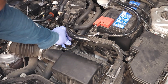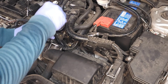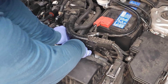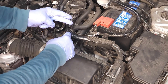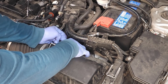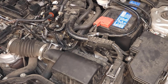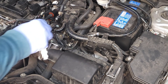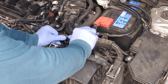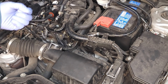Very carefully with two hands, press the sensor into place. Making sure that O-ring goes right down the center — kind of rock it back and forth a little bit. Grab your screw very carefully with two hands; highly recommend it. Stick it in and then use your fingers to turn that screw. Once you can feel that it's threaded, you can start spinning it a little faster until it's finger tight. Now come in with your socket and just tighten it down. It just has to be snug because this is all black molded plastic — if you tighten it too tight, you could break it.